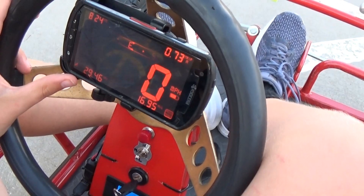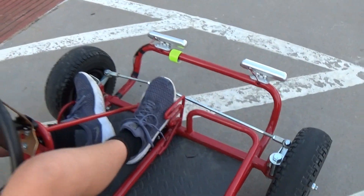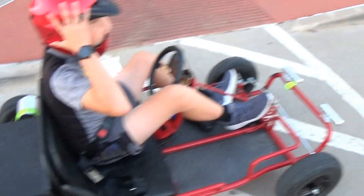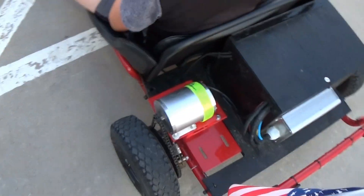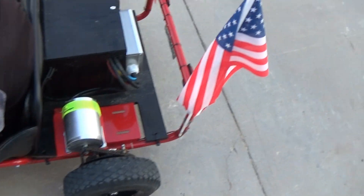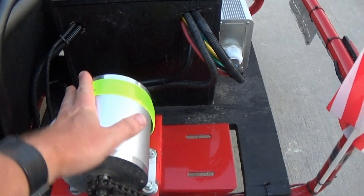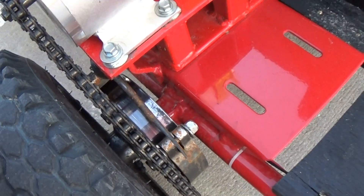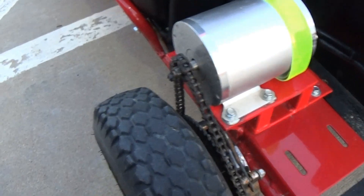The fact that we're so easily able to hit maximum speed with this motor tells me there's still more power available and the motor is just warm. I think if we go with a 50-tooth sprocket, we can hit 30-32 mph no problem and it'd still be a normal load for the motor.